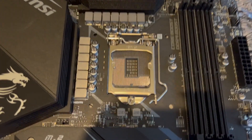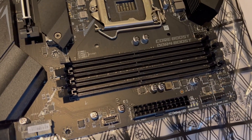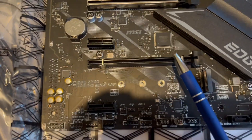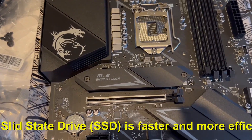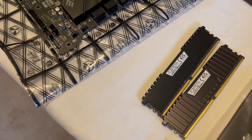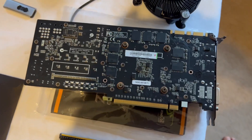On this motherboard, the central processing unit mount is here, and on the right-hand side you can see four slots — those are the memory slots. You can also see the CMOS battery, a slot for the graphic card, and two PCIe slots — Peripheral Component Interconnect slots. There is also the SSD mounting slot; SSD these days is faster and more efficient, and it has two slots — one here and one already installed. We have two sticks of DDR4 RAM, the Intel Core i7 10th generation CPU, a GeForce 4GB GPU with RGB fan, a CPU cooler, and a Wi-Fi adapter.